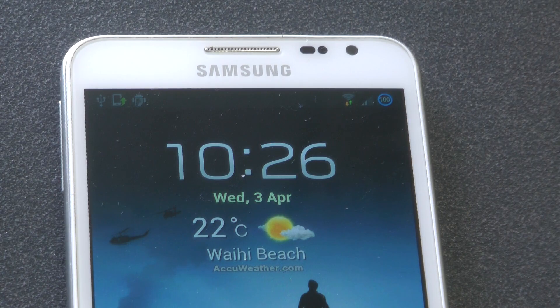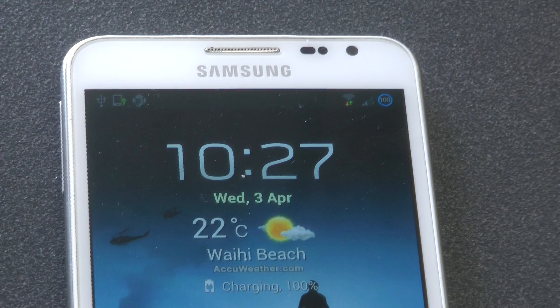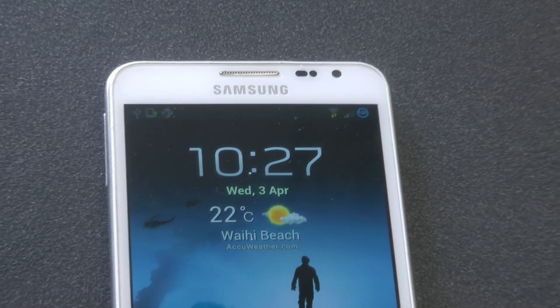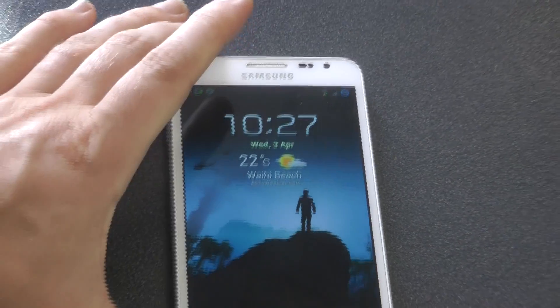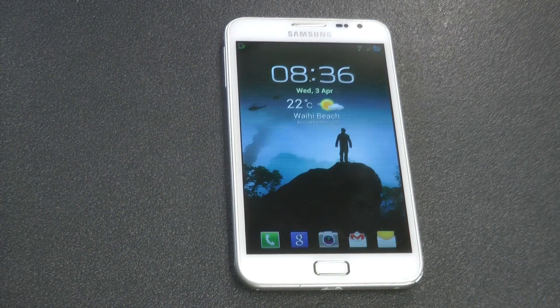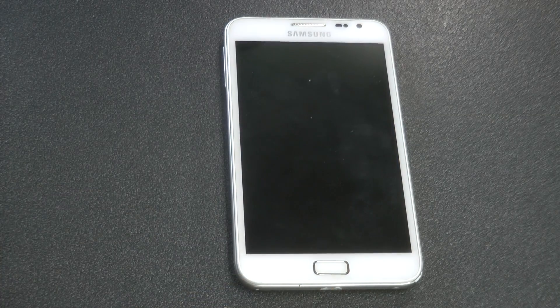As the title suggests, my phone thinks it's charging and then suddenly thinks it's not — as you can see in the top right corner, it's flashing on and off saying it's charging, not charging, charging, not charging. That in itself really isn't a problem, but because it thinks it's charging, my CPU clocks up, which means it's going to be eating my battery a lot faster than it should. So there's no deep sleep, even when the phone's off.